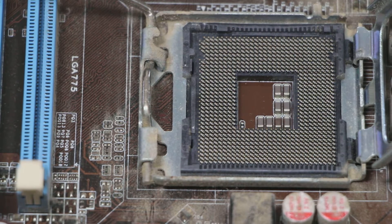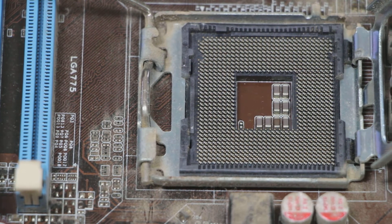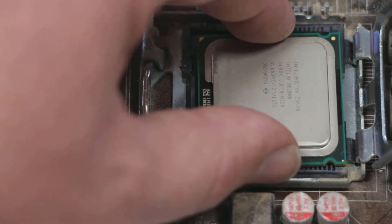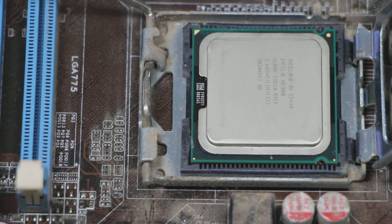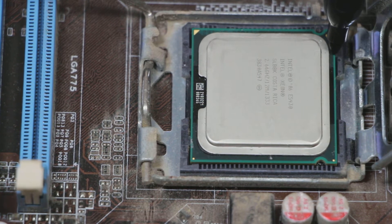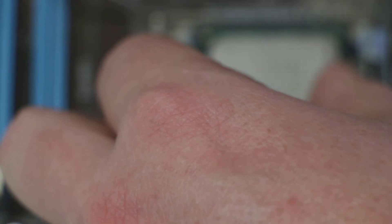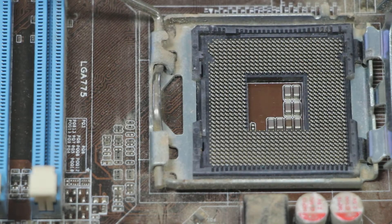I'm going to use one of my donor boards to mark these up — she's not pretty. Place the CPU in the socket in the correct orientation for a 775; pin 1 needs to match up, but it won't fit because it's a 771. I'll get a Nikko pen and mark the two notches on the left and right side at the top. These are the two notches we're making holes for in the CPU. The alternate option is to cut these out — it's Dremel time.